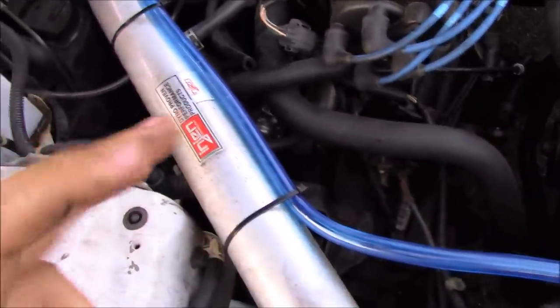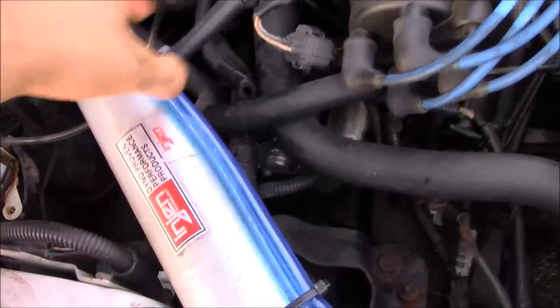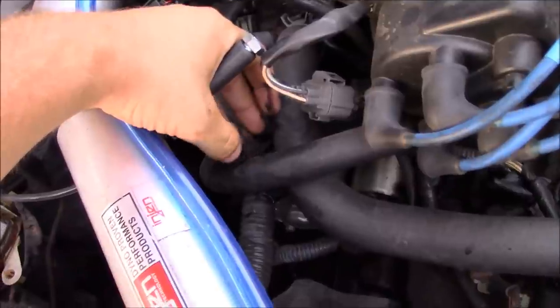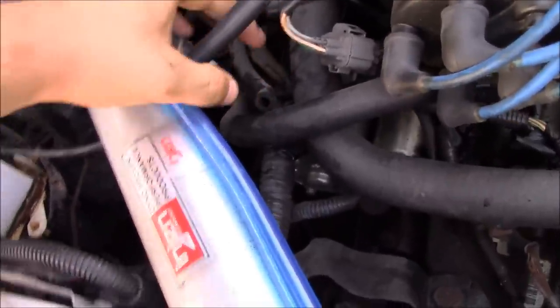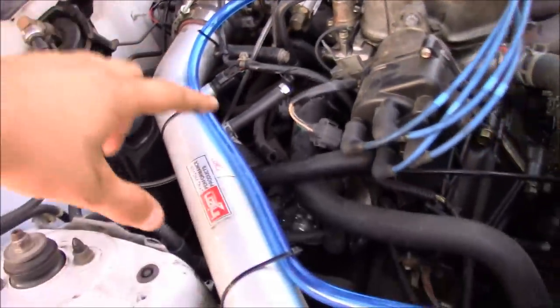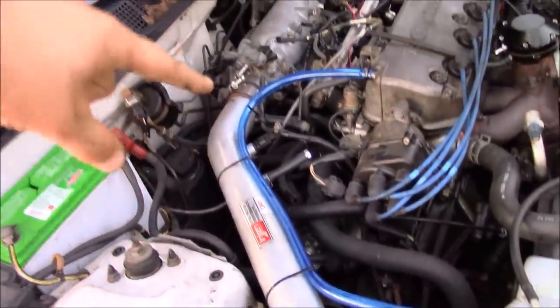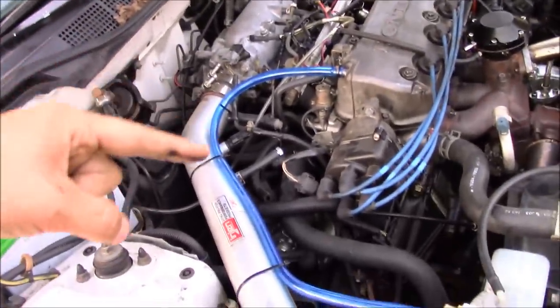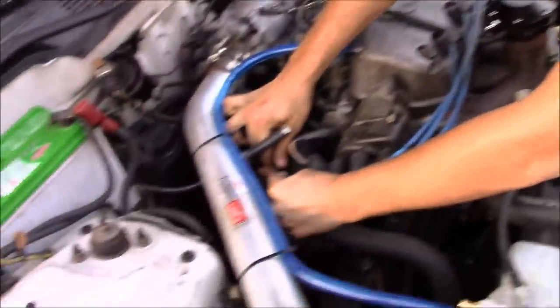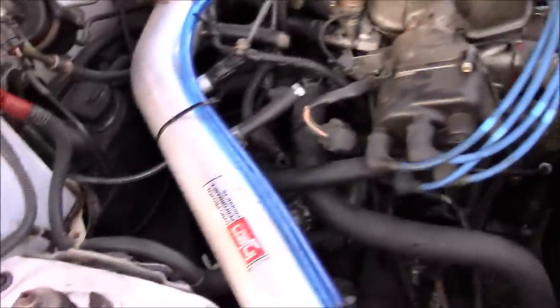Alright guys, while Payton was trying to do this and make his car better, I just noticed there's a hose down here. I thought maybe it was just a breather for the block or something, but that's definitely under vacuum while the car is running. It runs to somewhere over in there, so that means it's a vacuum leak naturally — and when it gets into boost, that's a boost leak. That may have been your issue with boost fluctuating.